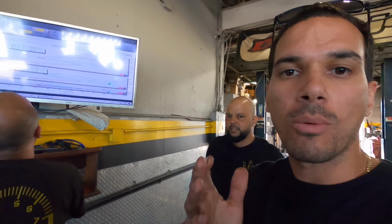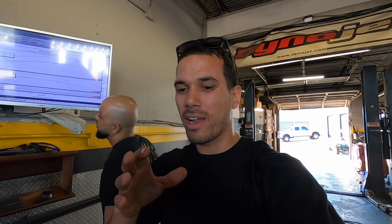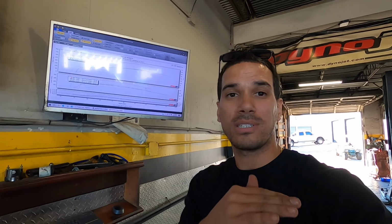What we did there, we gave it an all motor run, we gave it more RPM. Every time we'd race this car at the track, I would always shift it at like 5700, 5800. But in reality, both the times that I've gone to the track, the timing has not been quite right. It's been too much timing, and I felt it kind of fighting itself up top. It loses power, so I would shift earlier. So I thought maybe the max RPM was say 6000. And what the gear ratios got at 6000 RPMs in third gear, it was only good for maybe like 108, 107.